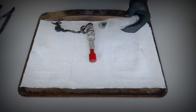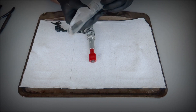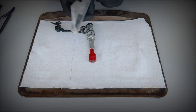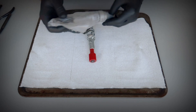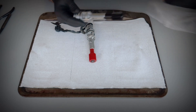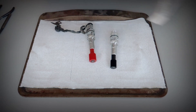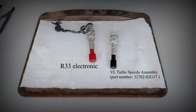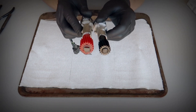But it's not only limited to that platform — it can be applied to whatever platform you want. What you're doing is taking this speed sensor here that we purchased and converting it to be installed into the RB25 trans. There's a couple of modifications you need to do: swapping the red cog over to where the black would be, and the retaining clip — you have to machine down a spot for that clip on the side of the sensor.